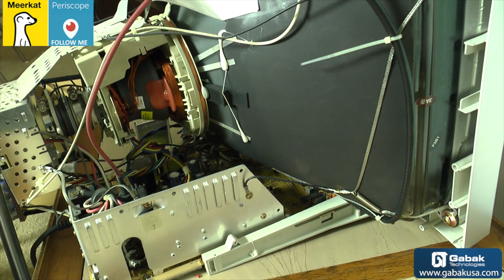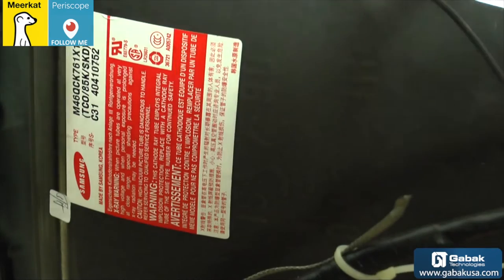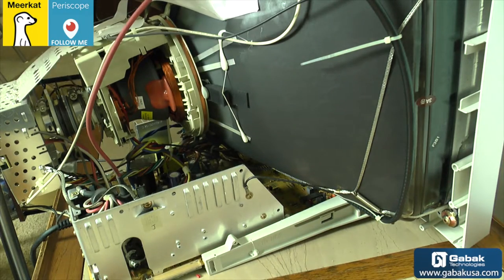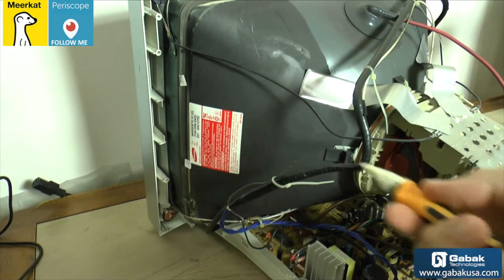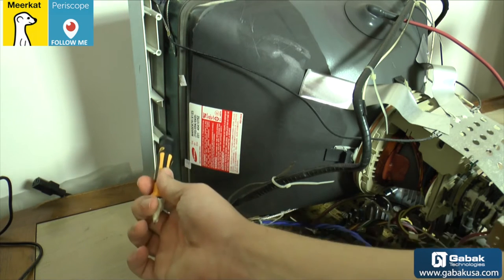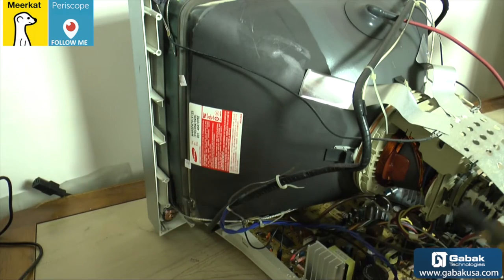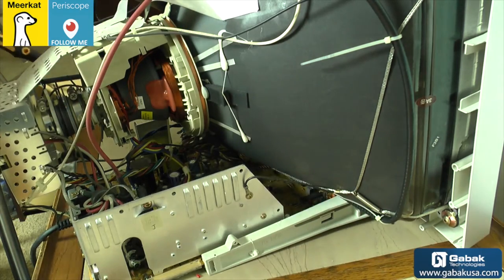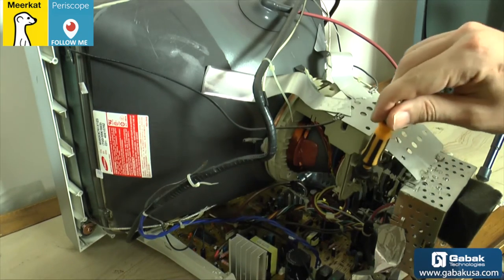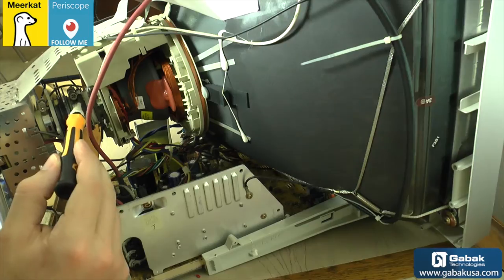Remember, back in the old days when people used this kind of monitor, their eyes got tired very easily because of all these X-rays and things that are bad. In this case, if you break the tube — they are very delicate — instead of exploding they are imploding, because there is a vacuum inside. The front is the thicker part of the glass, and the back is the thinnest. If you hit the thin part just a little bit you may break it, so in the front it is more resistant to any damage or hit you may encounter.